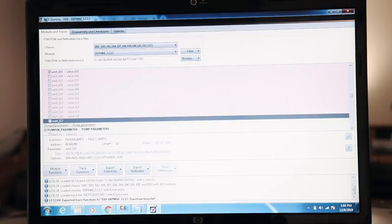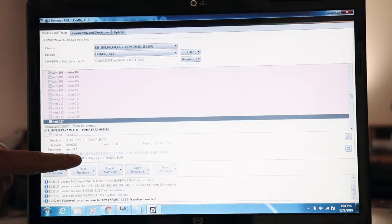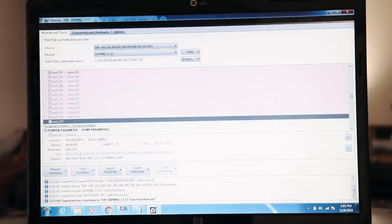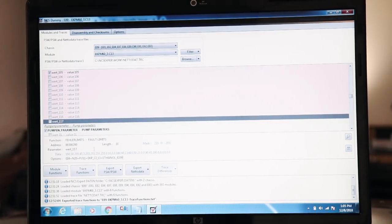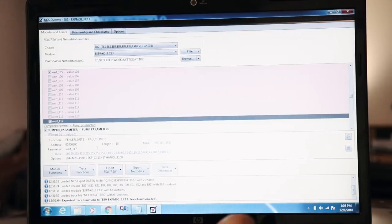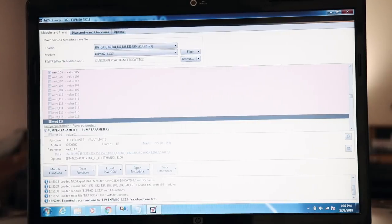What they've done from the factory for the X1 with the active flex, the one that's meant to run on 100% ethanol for Brazil that runs this module, is they just basically pegged that. They got rid of the feature. They made it as high as they could to basically ignore the fact that that car is running a lot of current, and it'll be so unproportional, because 100% ethanol on a four cylinder, you're going to need a massive fuel pump to keep up and flow an extra 40 or 50% more fuel. So what they did is they said, okay, between 0 and 255, let's just peg it at 255, basically ignore it. It's a value that's never going to come up. So that feature is missing on that car. You won't be notified when your fuel pump's pulling too much current, technically, on that car, but it's a trade-off.